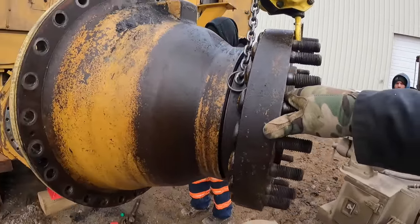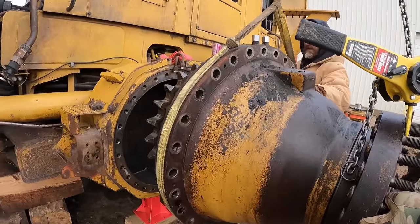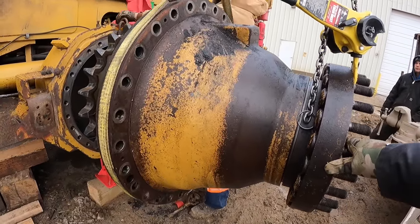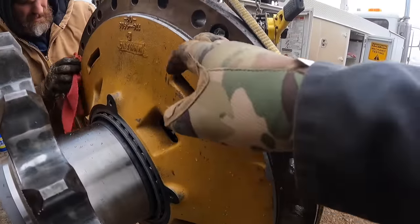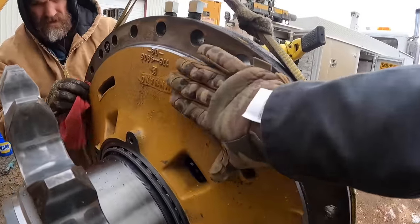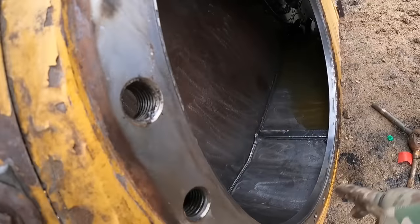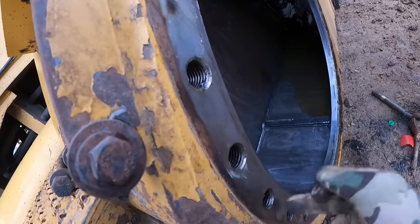Turn on your outrigger - there you go. Let it rest. We're cleaning the O-ring face right here. A big O-ring goes on this side, and this little groove right here is what it sits in, which is what seals it. Then we got to Teflon from here down, like I mentioned before.